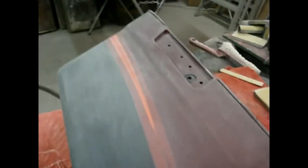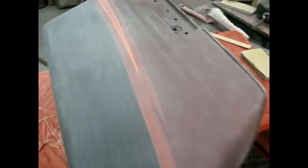So you have it under prep. That's ready for a coat of primer now. There's just a few spots on it. These are in such good shape you could probably get by without priming them. I could probably 320 or 400 this right now and seal and paint.